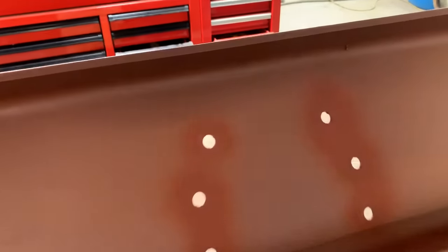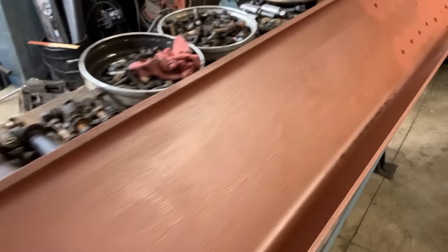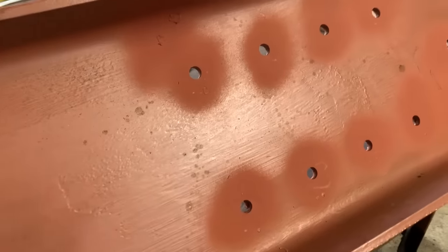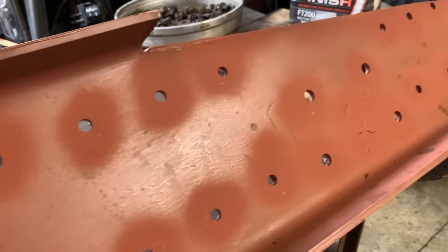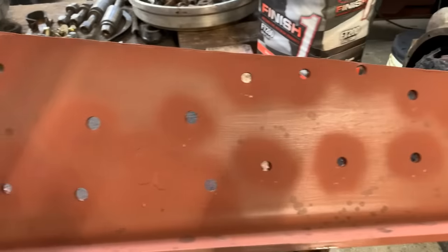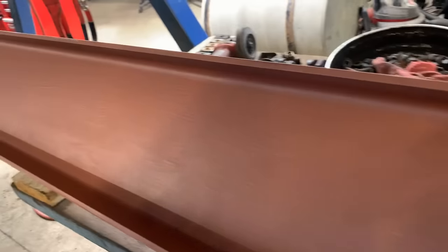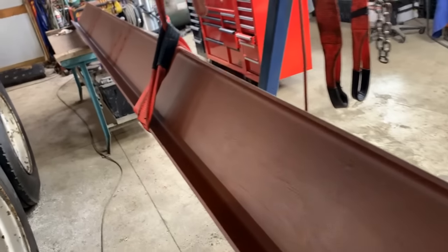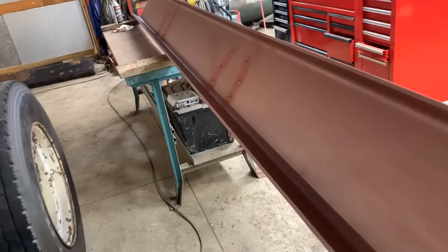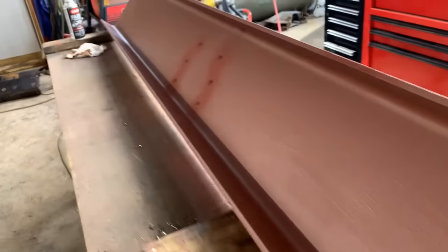Okay, primed, ready to go in. I just don't want any corrosion. Not in my lifetime, but this frame isn't going to rust even when my boys keep it another 50 years. But you don't want to leave any bare metal. I'm going to put a little Fluid Film on all the bolts when I put them through, that way they can't rust in the bore. Man, I'm getting excited. It's coming together.